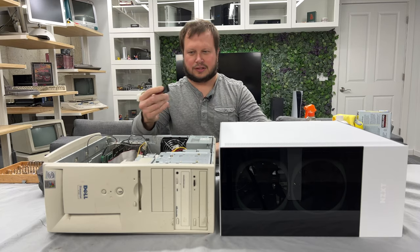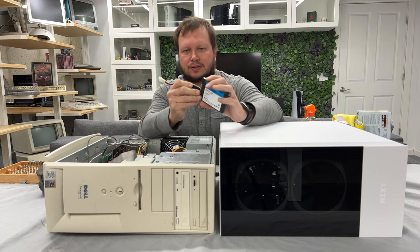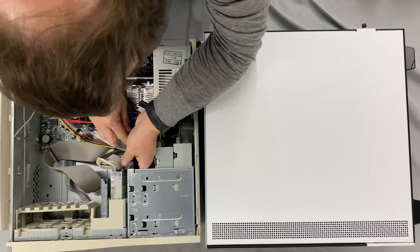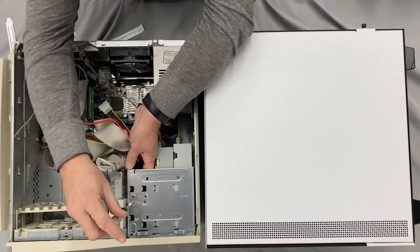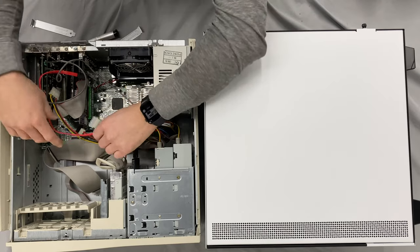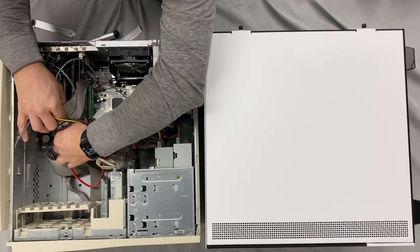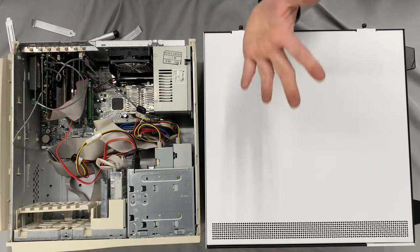Found one — very excited. That's going to give us SATA power from a standard Molex, plus the SATA cable. It's really lightweight so any screw that can hold it in is what I'll go with. I also don't have the Dell drive trays, but even that one screw is definitely in there really well. We'll connect that up to our SATA controller and then connect this to our Molex for power. That should be it.